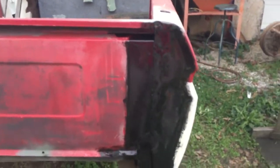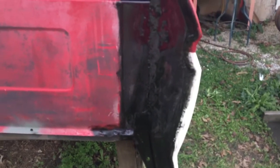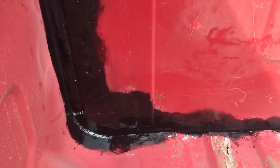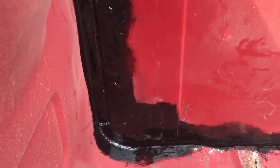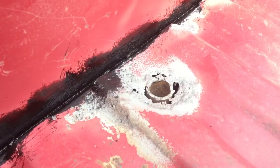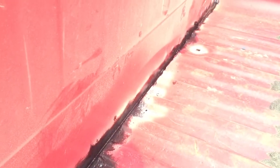Got it put in and smoothed off — that's the POR-15 on it, there's my patch right there. You can see it with the paintbrush. That's good, airtight — that's the POR-15 on some of the rough places in there. Got that done. I'm going to put some seam sealer in there, but I got that sealed off pretty good. When I get the bed liner put in it'll look fine. Still got some spots to go — just ran out of time today. That was a pretty bad couple of spots right over there.